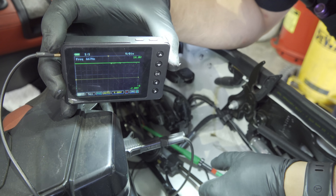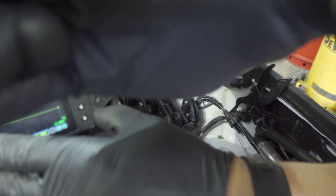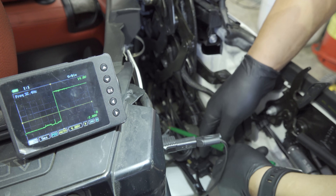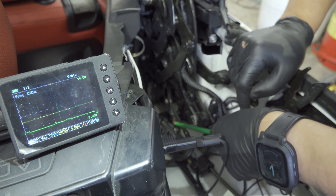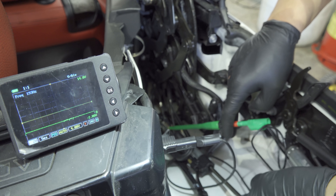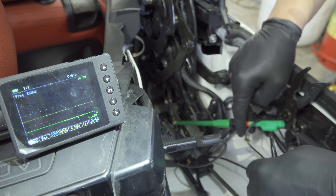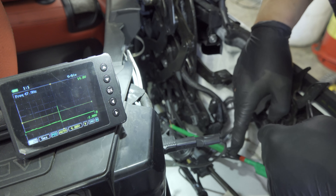We are noisy, so I'm going to try to move the strut while keeping everything else from moving. I'm not fully tightened, but for some reason I'm getting 12 volts there — I think we see our problem. Now I'm holding everything still except for my wiring, and we have noise. But when I move the whole thing — we've got 12 volts. We may have a harness issue here.